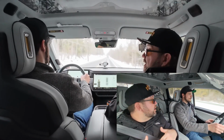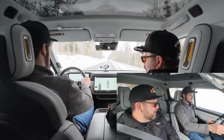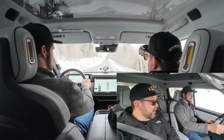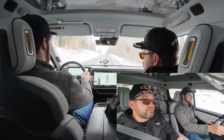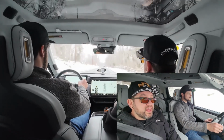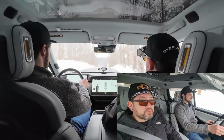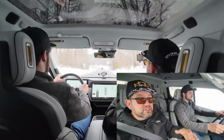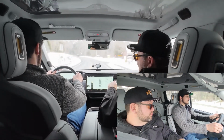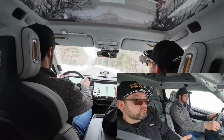But those panels do what? They protect everything. When you lift a brand new BMW or Mercedes, you don't see anything. It's all panels. They do that for wind. The wind gives you better fuel economy, gives you better aero, and it keeps the components away from stuff that could rust. So by having an electric vehicle, you're already that much further ahead. And everything else on this vehicle, Rivian specific, all the control arms, all the spindles, all of the steering and suspension components are all aluminum, and most of these are forged aluminum, not just cast. So they're super strong, and they never rust, they never rot.